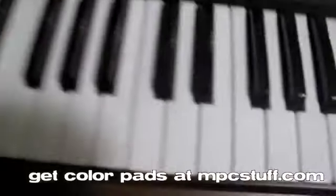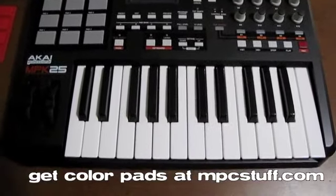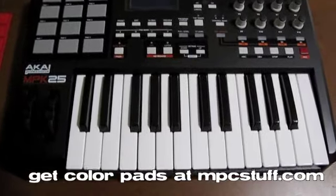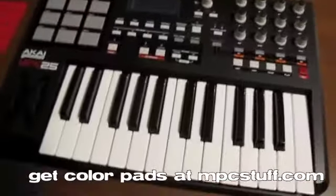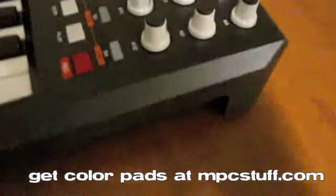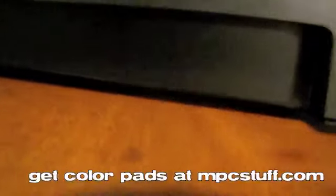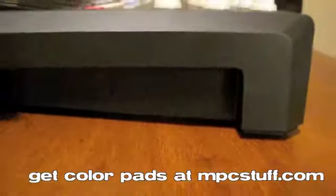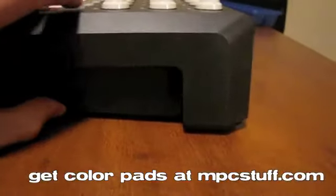Now that you've got all the bigger screws out of the bottom holding it on, you'll be able to get the face plate off. Now that you've removed all the screws out of the bottom, with the exception of the little teeny ones, you're going to take the top panel off. Keep in mind when taking the top panel off, right behind this section right here, there's going to be a couple ribbons that are going to hinder you from pulling the top panel up. So go very slowly and you'll realize this front end has to kind of come forward a little bit so it doesn't interact with the keys here.